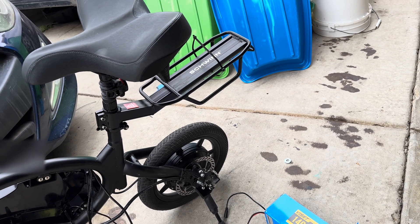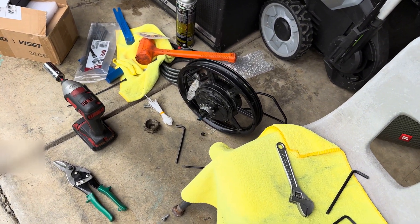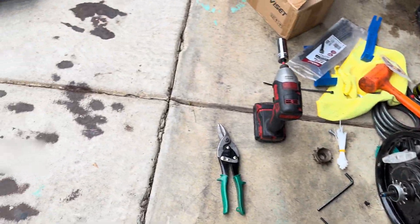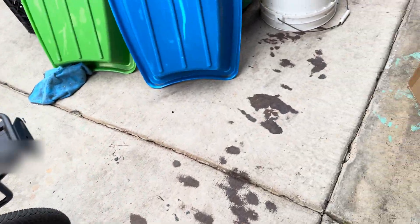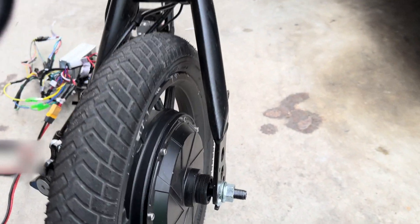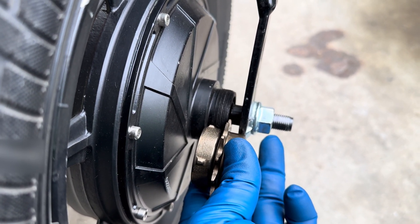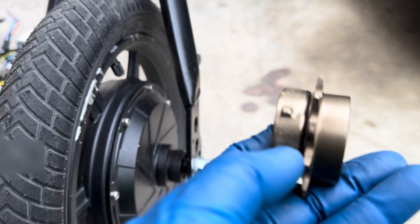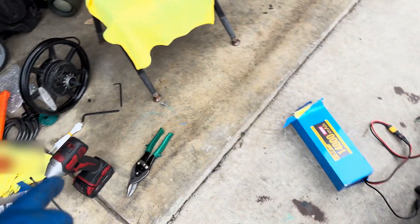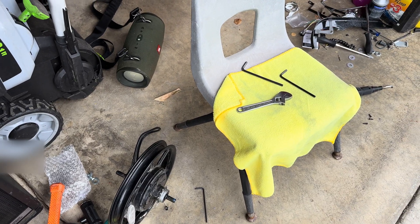There's also the stock 350-watt hub motor. If you're going to swap motors, you're going to lose power and pedal assist — and that's the thing I'm trying to get fixed. I have another sprocket here and my original thought was that it would clear the frame, but when I tried it, you can see it's already colliding with the frame. So I have to either shave it down or remove that one, but I'd need a special tool and I don't really want to bother with that.